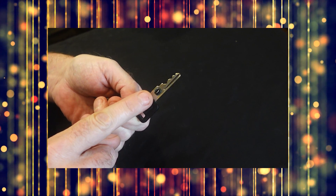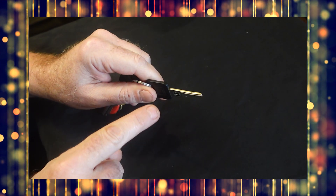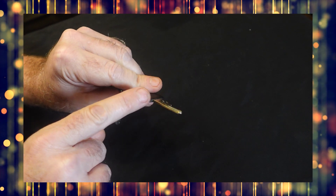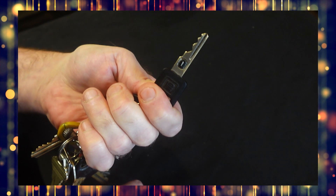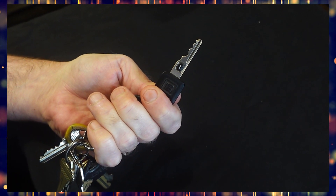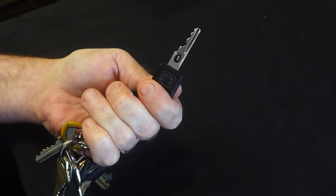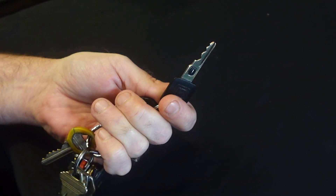It's a simple system that works like this. If your car uses VATS, the key will have a little resistor embedded in it right here in this little puck. When you stick the key in the ignition, it sends a small current through the puck, and if the resistance isn't just right, it shuts off your fuel flow. It's actually a pretty good system — it's served them well for years. After all, this is a simple resistor, not a chip of any kind, there's no battery. It's just a plain old resistor that'll last virtually forever.